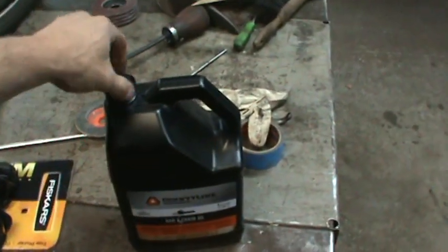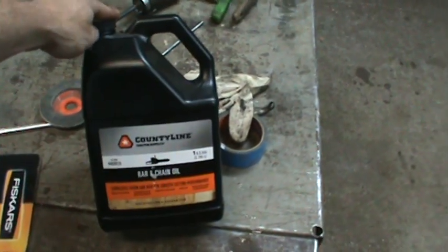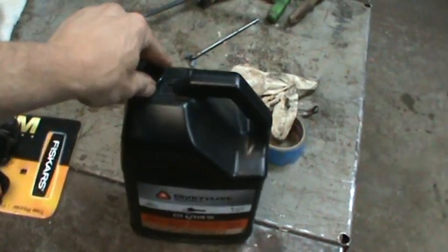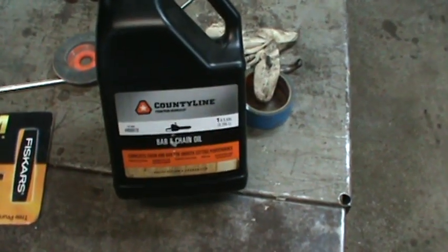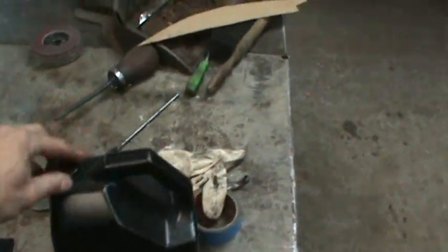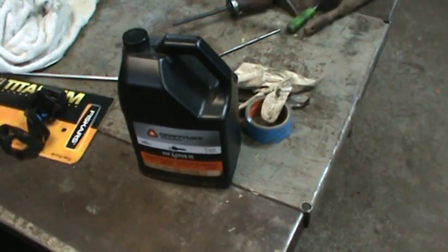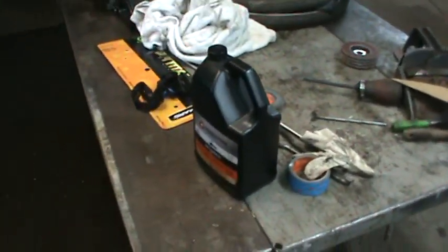To do on the inside of the rail, I'm probably going to thin it down with something — I haven't tried exactly what yet. Maybe mineral spirits — is that what I'm trying to think of? And see if I can spray it through a spray gun. Also I have a wand that you stick in a jar and you can spray — I think it's for degreasing an engine, one of those Harbor Freight deals. I can stick that up in the rails and get the rails nice and coated on the inside.